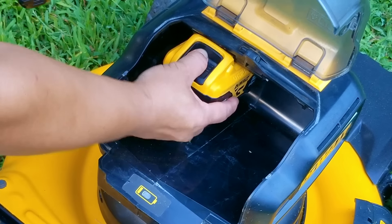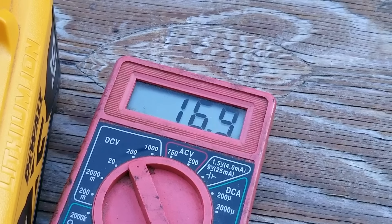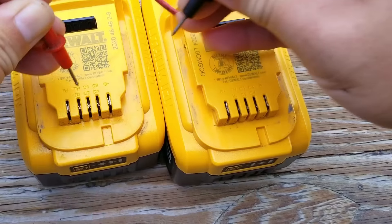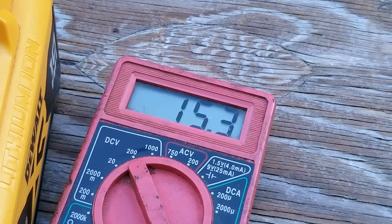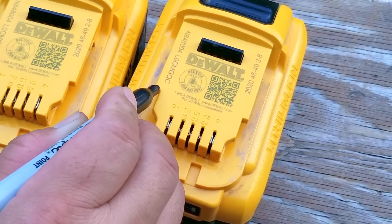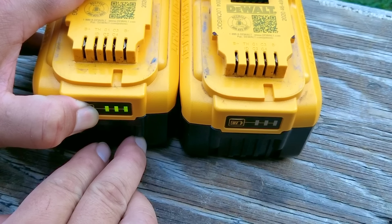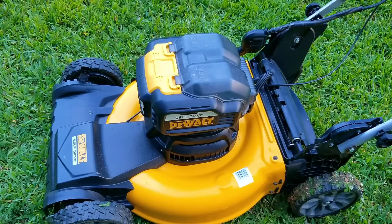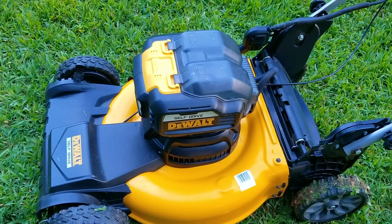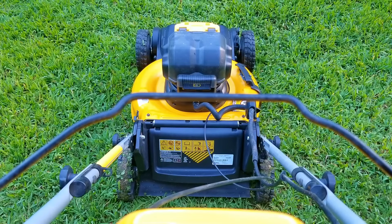After the run test, the first battery pack is down to 17 volts — close to what it was earlier. The other battery pack didn't fare as well at only 15.3 volts. I'm going to mark the pack that seems to be the bad one and let them both cool down before charging. The battery indicators do work but they don't show the whole truth. I did another test and mowed the backyard using the self-propel — and it only lasted 13 minutes. That's three and a half hours to charge each battery for not even a quarter hour of mowing.